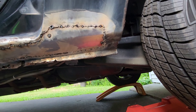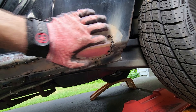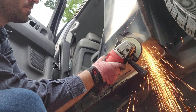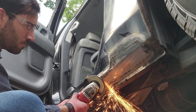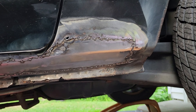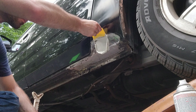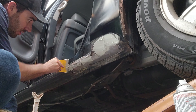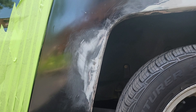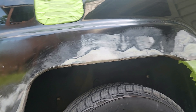It's all welded in there. Pretty much stitched it all the way around. I think I'm happy with how it is right now. I'm going to grind it down a little bit, see if I need any more welds. It's sanded down, it's nicely in there. Next step, I'll use a little Bondo and then paint it black. I finished the first layer of Bondo. I'll put a little glazing putty on there and paint it. While I was at it, I took care of a couple of rust bubbles around the fender.